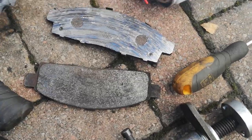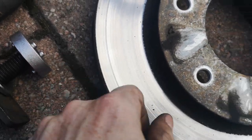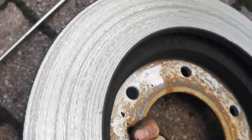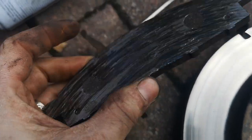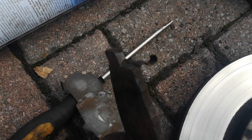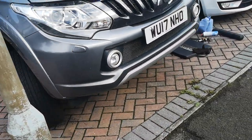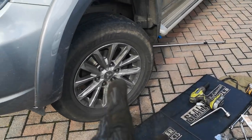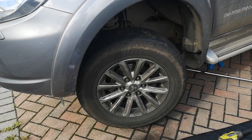We interrupt this timelapse to look at the other brake disc. On the outside I thought it was just starting to go, but the back was all bad. Here's the pad — and this is the one with the wear indicator, which has snapped off. There we go — that's both sides changed. It took about 20 minutes to do this side and about 30 to 40 minutes for the other side because it was more of a fight, but that side was more damaged — everything got hot and horrible.